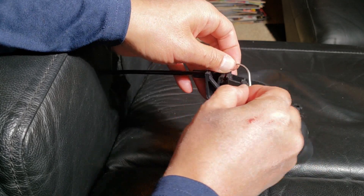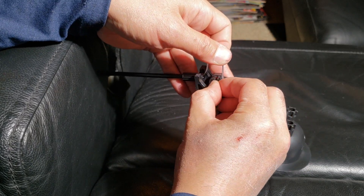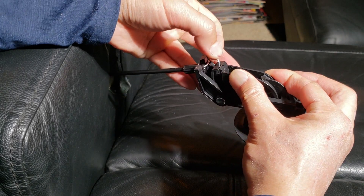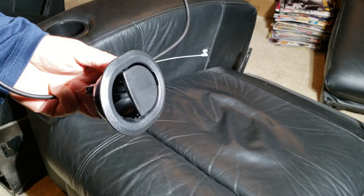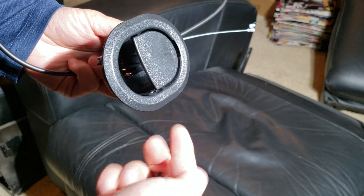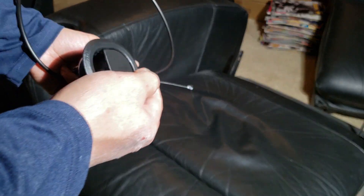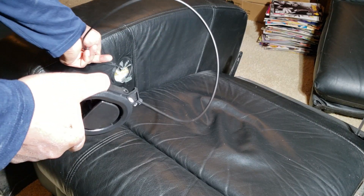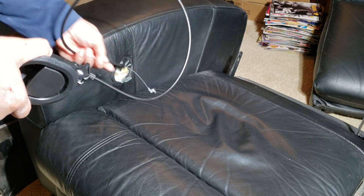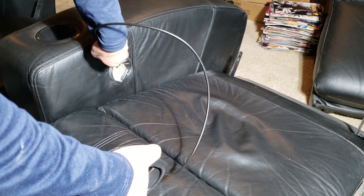Make sure it's got high tension, then insert the drum into the cylinder right here. Line up — okay, we're in business. I just have to tighten the tension down below. Make sure you saved the screws from the old model because the new one doesn't come with them. I'm going to insert the cable back in here — don't tighten it down yet. I need to lead the cable so it falls into the area underneath.